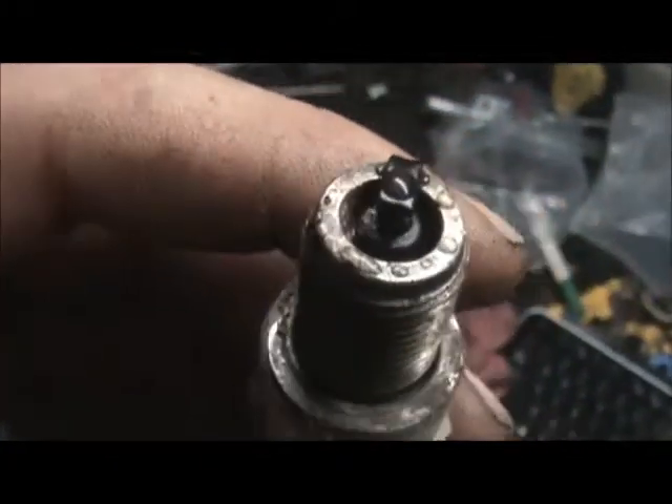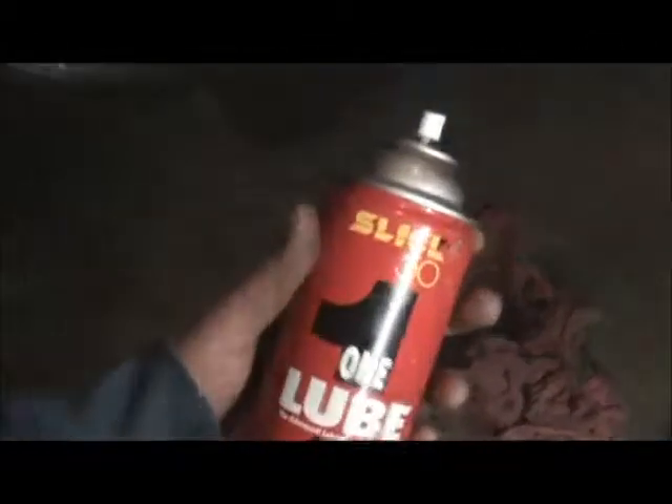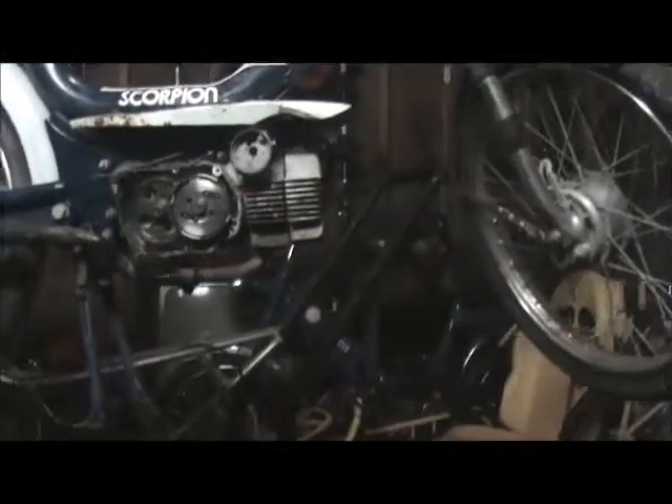I kept screwing around with her. Pulled the plug and there was lots of water. So I sprayed some Slick 50 in there — quite a bit — and then just took a ratchet to the clutch and turned her over. Spark plug's out and now she's broke free. Took a little bit of back and forth getting her rolling on her own. So it does have some compression to it.